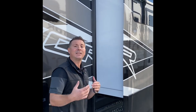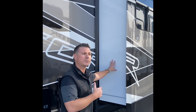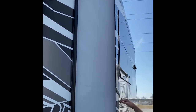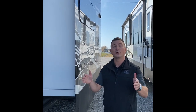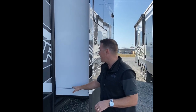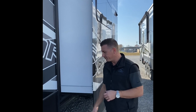And then if we take the technology that we put into the TruePoint 5-point technology in our slide boxes, what we've then been able to achieve is by reinforcing that roof, we're able to get a true fit when it's coming in and out. So you'll notice when you're on the lot and you're hooked up and you're running the slide out, if the slide's wanting to shake when it's going out, or as it's almost getting in and it wants to shake a little bit more, you're starting to notice that it might be off center somewhere, which is what's making it shake. So by doing this cable system, we're able to pull all of those in smoothly and run them out smoothly, which again is gonna help extend the life of the camper for that customer.